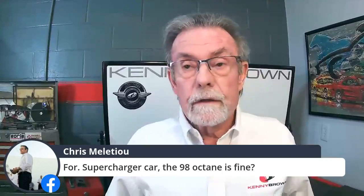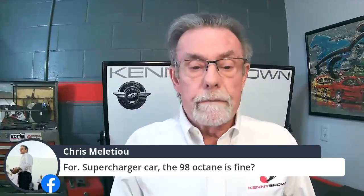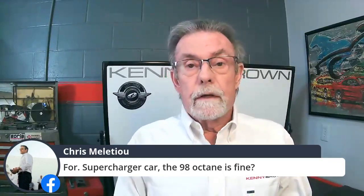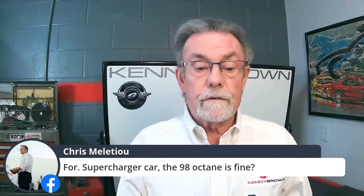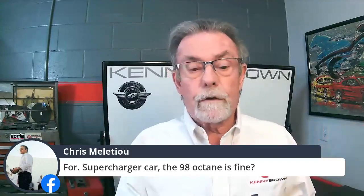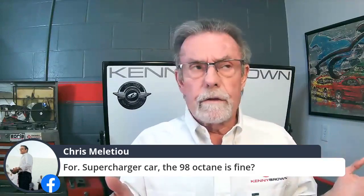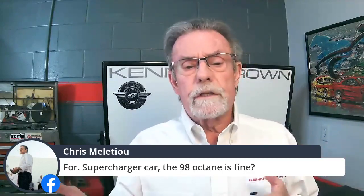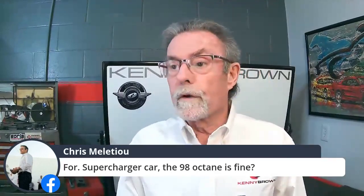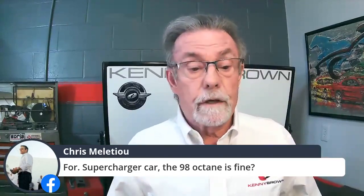And they've got unleaded. If you've got a supercharged car, I strongly recommend high octane for supercharged cars on track just because of the heat. The more heat, the more chances there are for pre-ignition. We can just look for Sunoco or BP, and both of them have like a 90. I think the Sunoco is something GT, and it's like 98 unleaded. BP, I can't remember what their numbers are, but we use BP in World Challenge. They've got something in the same range.